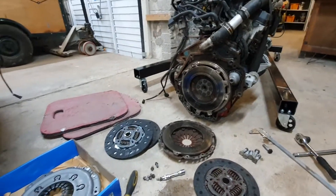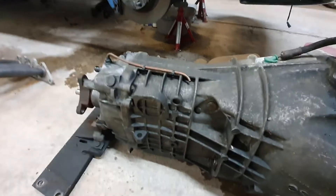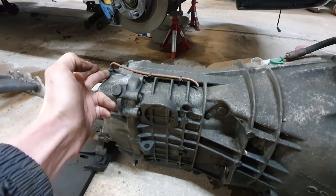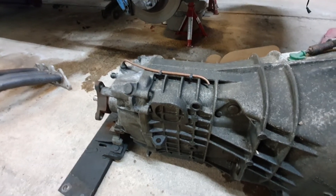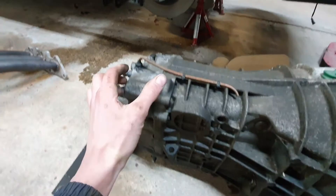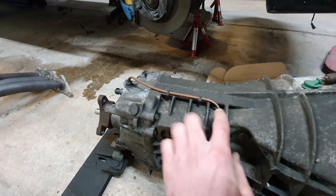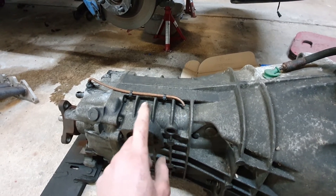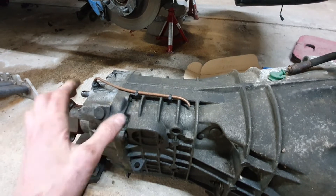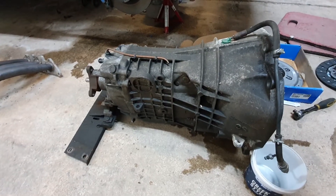What I found was this combination — the light car, the very light flywheel, the performance in first gear was just fantastic — and the acceleration is so much that the oil swills to the very back of the gearbox and started pouring out of the breather. So I was regularly getting oil stains on the floor shortly after I'd accelerated hard. The solution I came up with was to block up the original breather exit, put a piece of brake hose in there, and now the breather entrance is further up. So it can still expand and contract, air can come in and out, but when accelerating the oil swirls to the back and won't get all the way up this tube. I was quite pleased with that little fix.